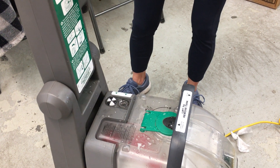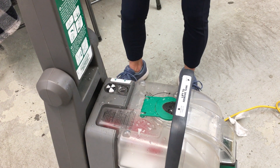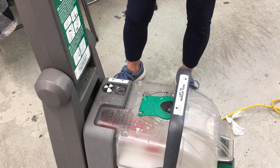If it sprays up like that and stays up, you know your flow indicator's good and your pump's good — you need to replace the solenoid valve in the bottom of the machine, and we have a video on our website for that.